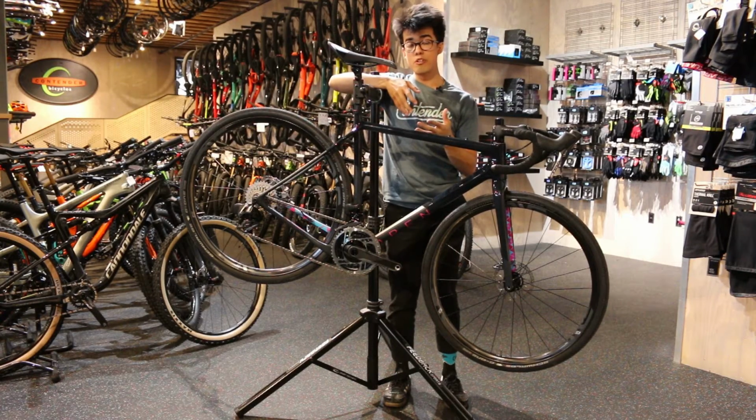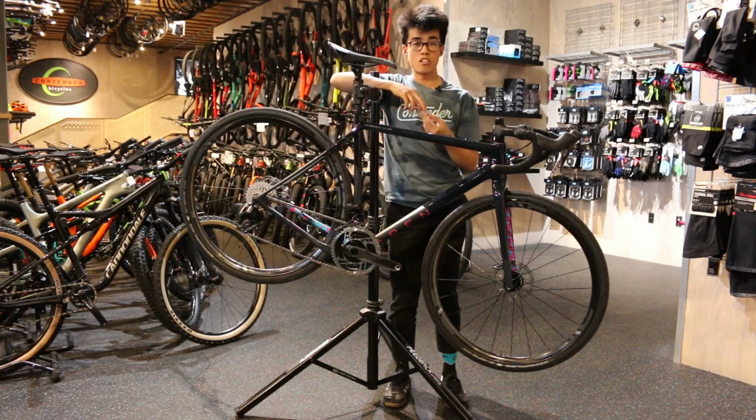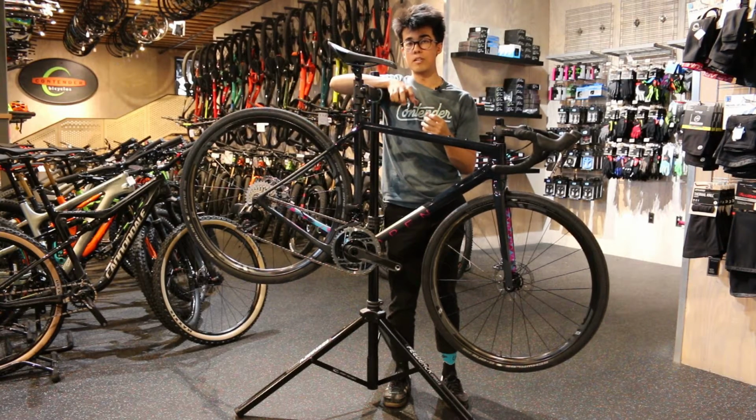The key to this rear derailleur, however, has to be its orbit damper, which allows this single rear derailleur to be run as a 2x or a 1x option. The orbit damper adds no additional friction to the drivetrain like a standard clutch might, but when it senses that the chain is jumping quite a bit, the fluid inside will actually activate and it will limit the amount of chain slap that there might otherwise be.